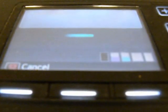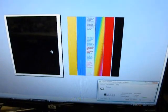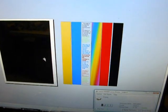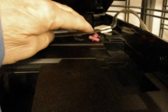And if you notice, that color has been grayed out. Now those two colors won't come back up again. Now, if you were to put Canon cartridges in, all the ink levels would come back up. The printer would operate just like the day you got it. So using the COC chip makes it a lot easier. Because now, once that happens, you just keep printing. You don't have to keep opening the lid, taking out the stopper, letting the cartridges come over. You don't have to do that anymore.